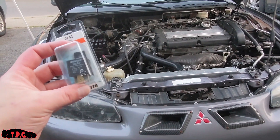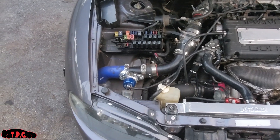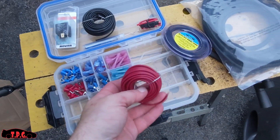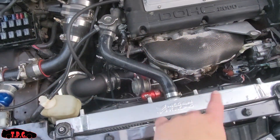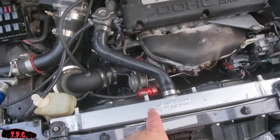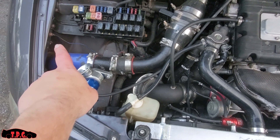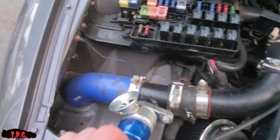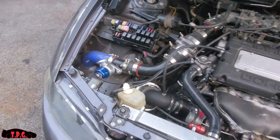I'm going to show you guys how to wire a relay to turn your fans on off of 12-volt power. We've got some rolls - I've got a black roll and a red wire, 14 gauge. We've got our relay, our inline fuse, some connectors and crimpers, some strippers, some wire insulation. We're going to go through all this step by step. Fans have two wires coming out of these Spal fans - one of them the ground, we're actually going to ground to chassis on both fans. I'm going to make a line that comes off to the side and grounds right here where my ECM link MAF cable grounds out. I'll use that same ground, or maybe find another one - there's a bolt hole down here I can fit an M10 by 1.25 in.